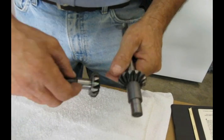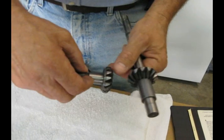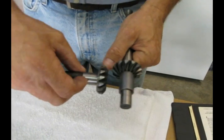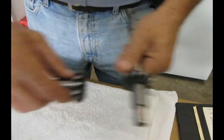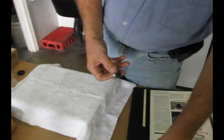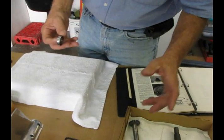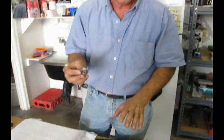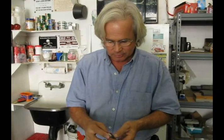But if it comes out of engagement or if its backlash changes, it'll break one tooth off. And as soon as it breaks one tooth off, that jams it and the failure is cataclysmic and profound. I could not find anywhere in industry where one of these bearings was used as a thrust bearing for a helical cut gear. This is actually a runout bearing — it comes out of the Yamato unit and takes the runout of an alternator. It is not rated for anything near this kind of load.